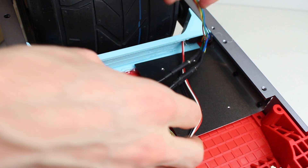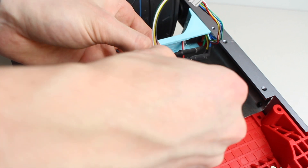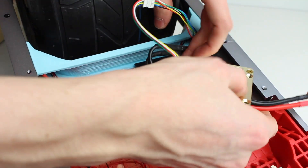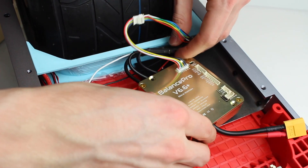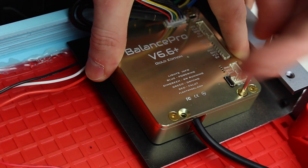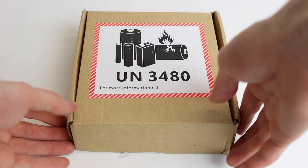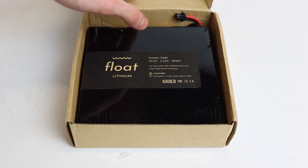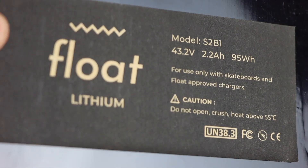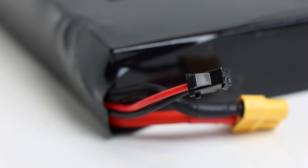We connected the phase wires from the hub motor into the VESC phase wires, and the hall sensor adapter into the hall sensor port on the VESC. The VESC used in the float wheel build is the Balance Pro, specifically made by Float Wheel — a great VESC for DIY one wheels with a built-in internal IMU, super useful for any self-balancing electric vehicle. The Balance Pro mounts to the mounting plate already secured in the rail using four screws. The battery is a 222 watt-hour 12S 1P Tesla battery pack made from 21700 cells — it's marked as 95 Wh on the outside but it's actually 222 Wh.